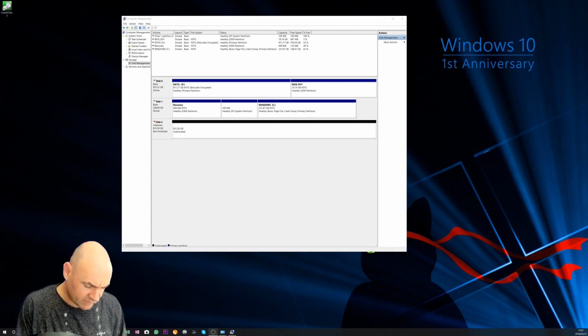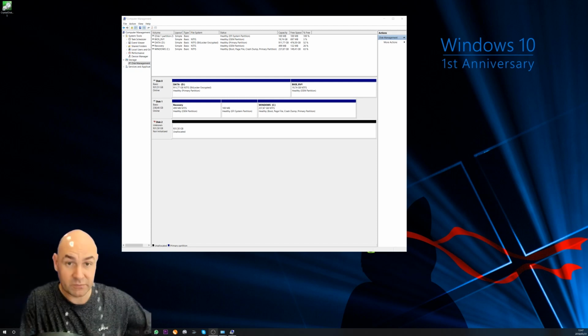Step 1, switch on the enclosure, switch 1 and 2 to off, then press the reset button until the light of disk 1 and disk 2 is on. It's turned to no RAID at this moment. Okay, so step 2, refer to the above switch. Okay, so you've got to do this in stages.